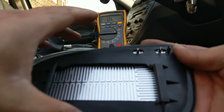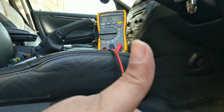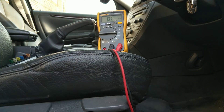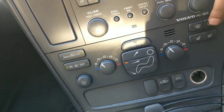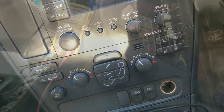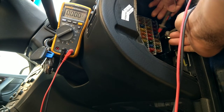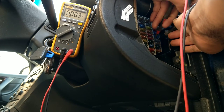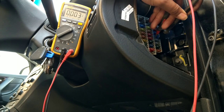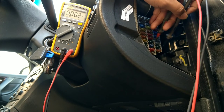That's a nice smoking-gun result — a clear difference in resistance. With the new mirror fitted, I turn on the heated rear window again and repeat the voltage drop test across the left-hand fuse, which shows the expected 3-millivolt drop confirming current is flowing, just as before.